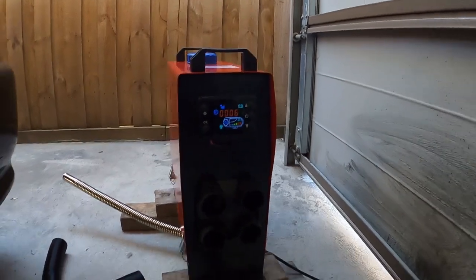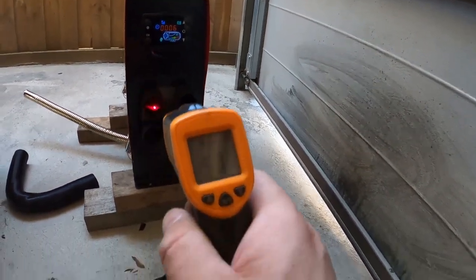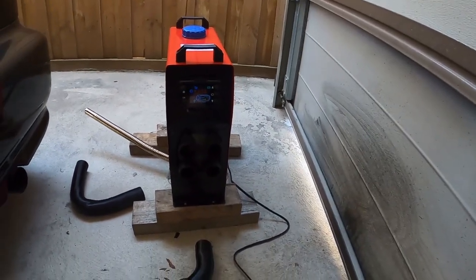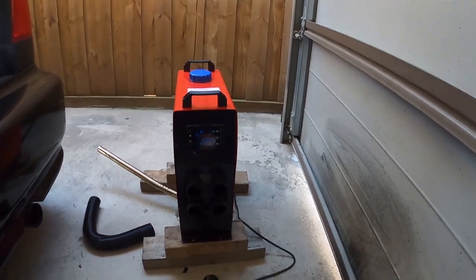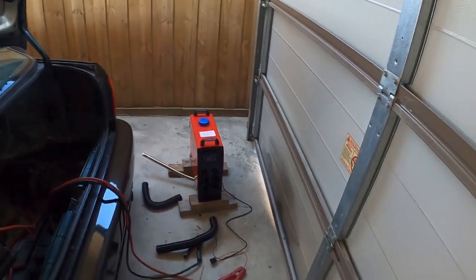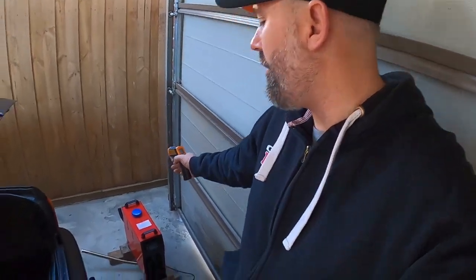So the lowest setting is one kilowatt. We've turned it right down and it's still belting out the hot air — 98 degrees, boiling. But all of that by only using 100 ml of diesel per hour, which is fantastic. Now I do have some criticisms. The exhaust pipe probably should be mounted more securely or be more flexible or longer. The air intake should also have a proper secure mounting.